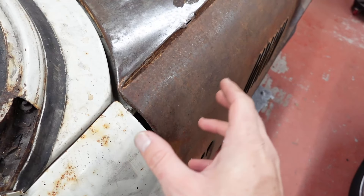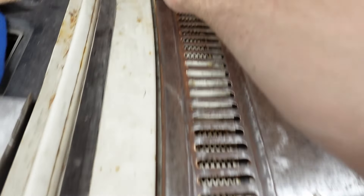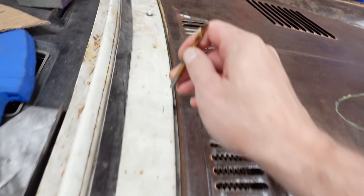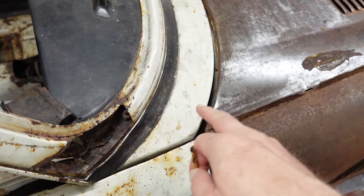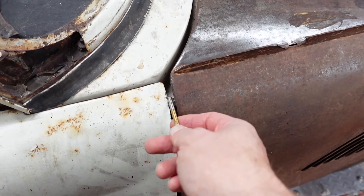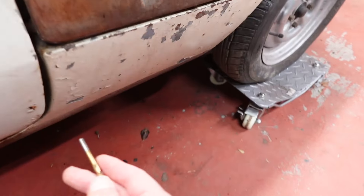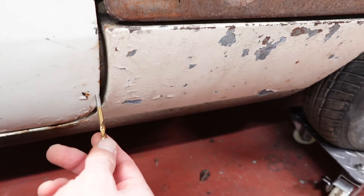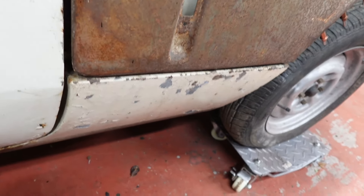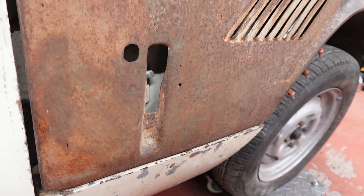I've been under and loosened up the plates that the bonnet kind of sits on, and I've managed to give this a shove back. So all across the middle, again a 5mm gap. It actually widens out towards the edge, but that seems to be because the curve of the bonnet and the curve of the scuttle are not quite the same. This has just slipped again, but that might be something I can do because the gap at the bottom is quite big here as well. This sill is getting replaced, so possibly the door wants a little bit of an edge in them. Also this isn't latched, so getting the latch in and getting that pulled down is going to change things again.